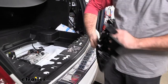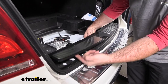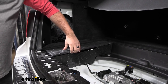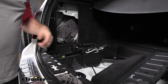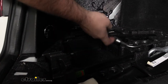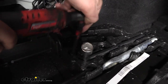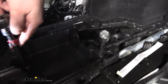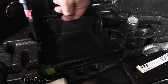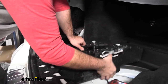There's a total of six clips that plug in here, so there's not a great angle to go from this side. If you want, you could use a plastic trim tool to pry and peel back the weather stripping and wedge on those to help it along. Now we'll remove the compartment where our jack is stored — this just kind of pops up, and the tray has two T40 Torx bits to remove. There's one in this indent here, and the other is located by the socket portion of the jack. We'll go ahead and get these removed and slide this out and set it aside.